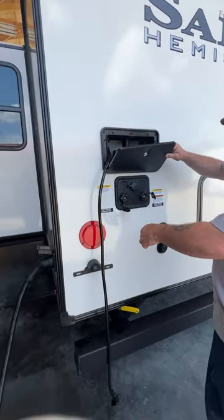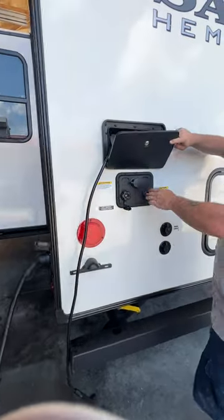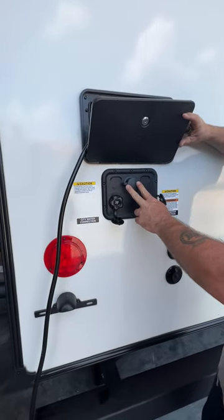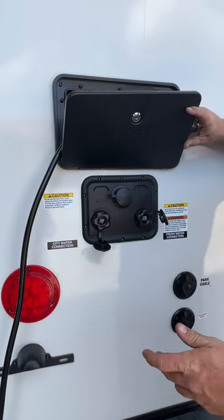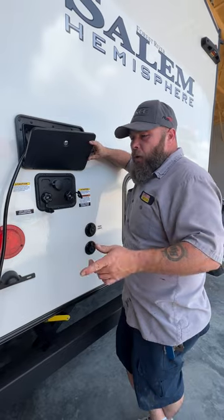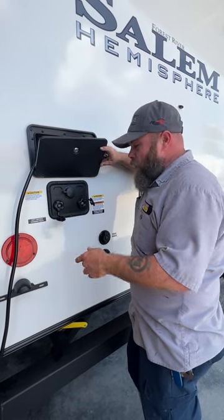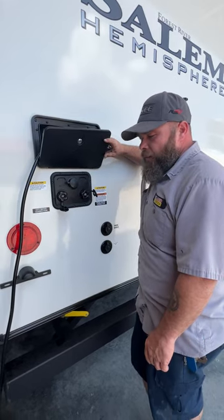You basically have your outside shower with hot and cold water. Underneath that is going to be your water station. Up here at the top is going to be your black tank flush — basically a sprayer inside the black tank that sprays around and gets the nastiness out. With that clear elbow, you'll be able to see when that water is coming out clear. You always do want to shut the water off at the spigot first. I do always recommend that you have a pressure regulator on there and a black hose — black tank, black hose. Keep it simple. On the backside, this is a plastic check valve, and too strong a water pressure can damage that check valve.